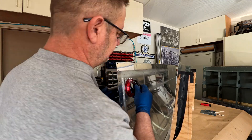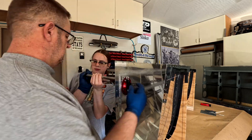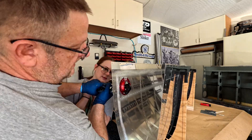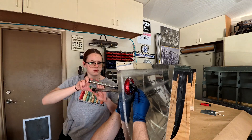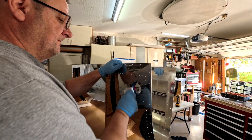It is pretty easy — there are only about eight, nine, or ten rivets on those. You do have to remember to put the little holder at the top that will hold your vent line in your fuel tank, and it does take a different rivet, just FYI.